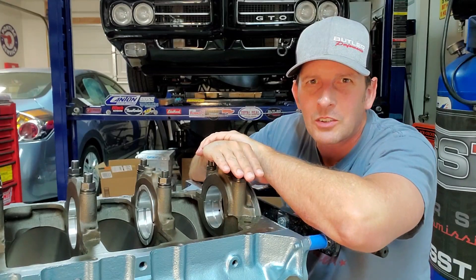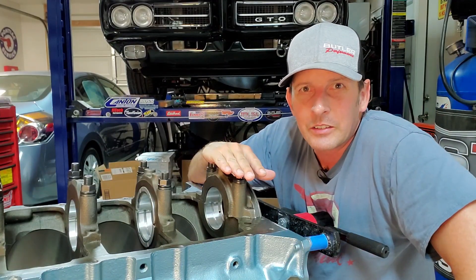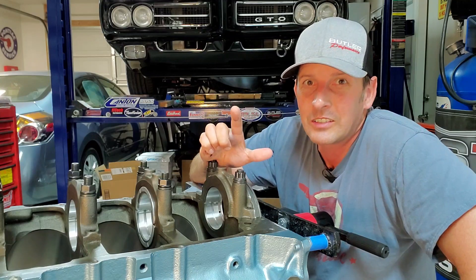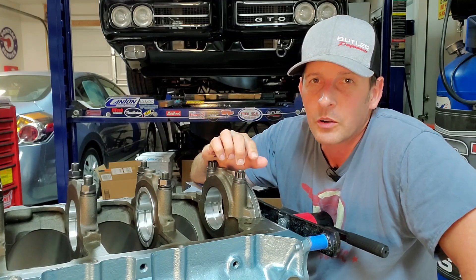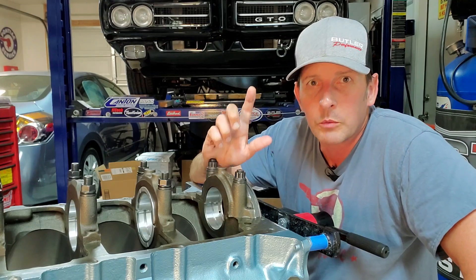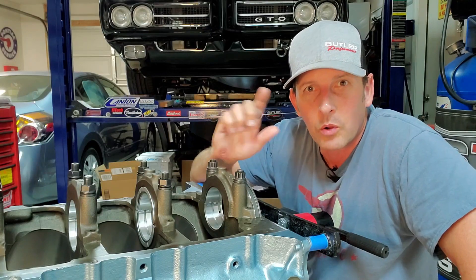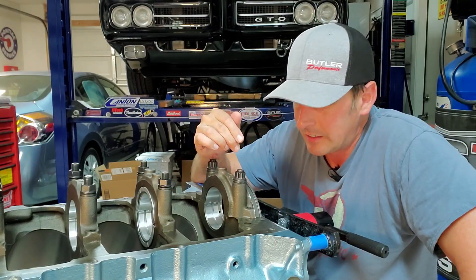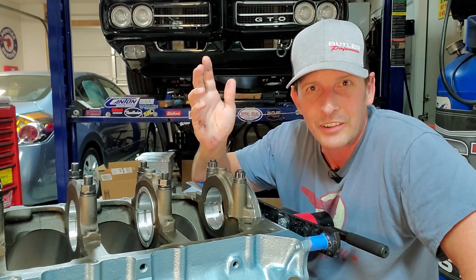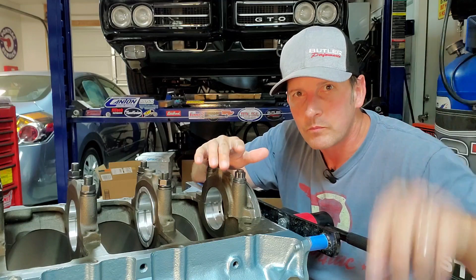Welcome back to Fast Monty's Garage. Today we're going to talk about putting the crank in and making sure we use a one-piece rear main seal. Some of you may not have seen it before — it's really cool. It replaces that rope seal in the rear main bearing that's prone to failure and causing a leak in the back of the engine, which is painful to fix because you have to take the engine out.